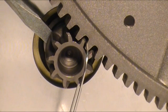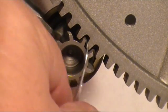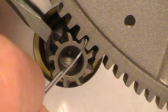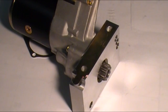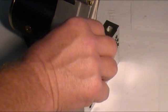With the starter installed, use a screwdriver to manually engage the pinion. Check the clearance with the wire gauge supplied. If the clearance is too tight, add one shim supplied. If it is still too tight, add the second shim. You should never need more than two shims.